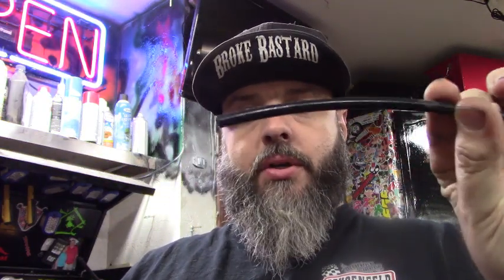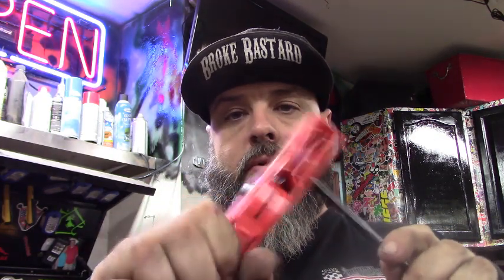Okay, so you've got just this PVC line that we use for the airlines, okay? Simple, easy, all day long, nice factory smooth cut. Now, if you're cutting these airlines with a pair of dikes, scissors, whatever, you're not going to get that nice clean line on it, especially with press fittings. You really want that nice even cut on the end so that when it goes all the way in, it'll lock and you pull it back, no leaks.